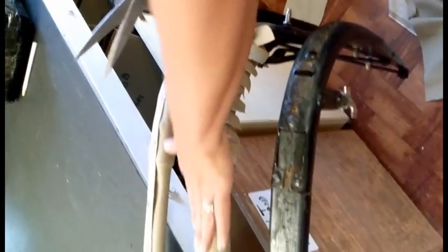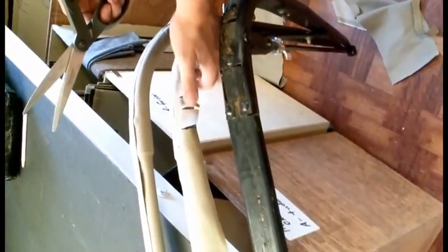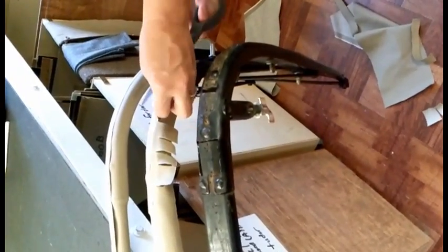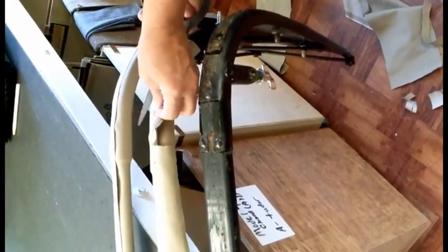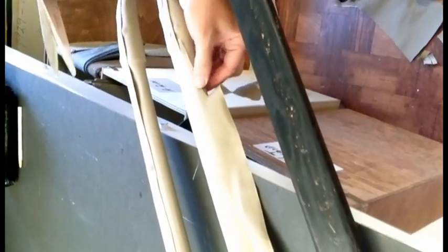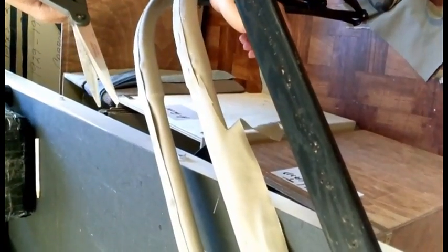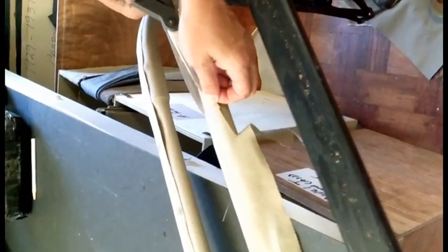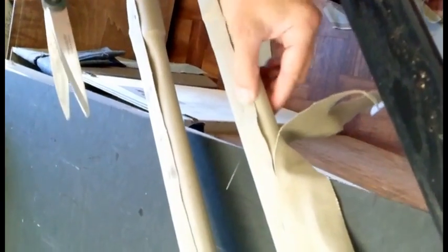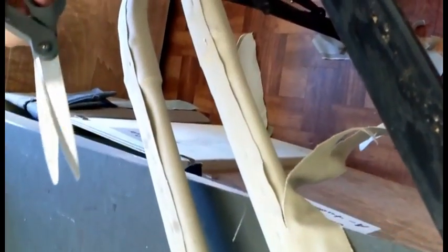We've got our bow wrap on, and we're happy with how it looks. On the underneath side it's nice and smooth, so we're just going to go ahead and trim all of our excess off. And the little rule of thumb here is you don't want to leave this so long. Like if we trimmed it here, this edge would peek out on the front side of your bow. So you really want to be back at least 1/4 of an inch from the edge of the bow so that you don't have anything peeking out on the inside of the car.